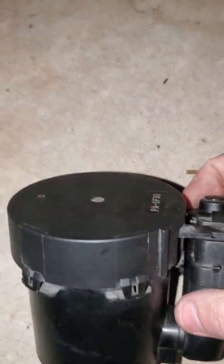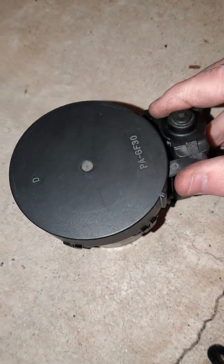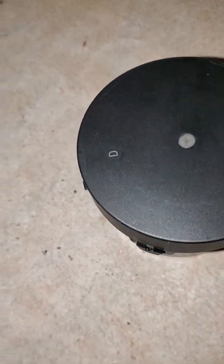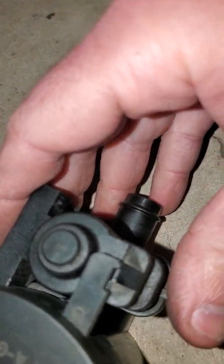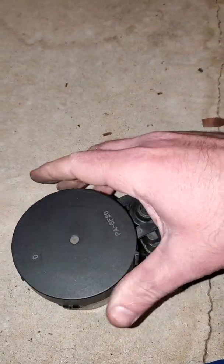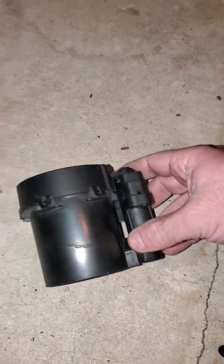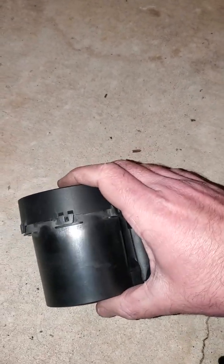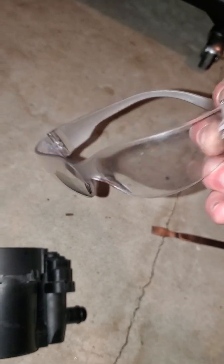I got the actuator back on the little canister thing. There's a little tab here that locks in. To get it off I just use my little pry bar — you can use a screwdriver or something. This snaps on and this is what keeps the actuator secure. Even after I cleaned it, it's still pretty dirty. This is all back together. I'll go show you where it goes in the car, because it's filthy under there and I was getting all kinds of dirt in my face.